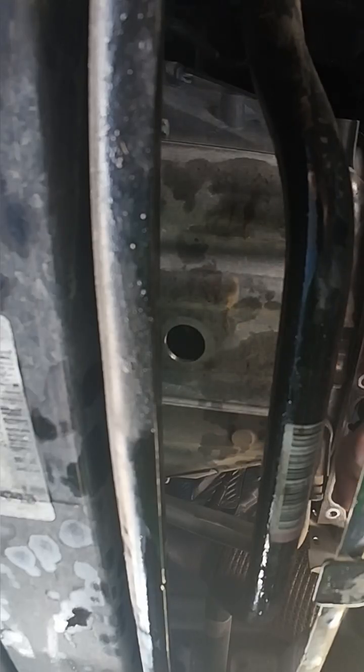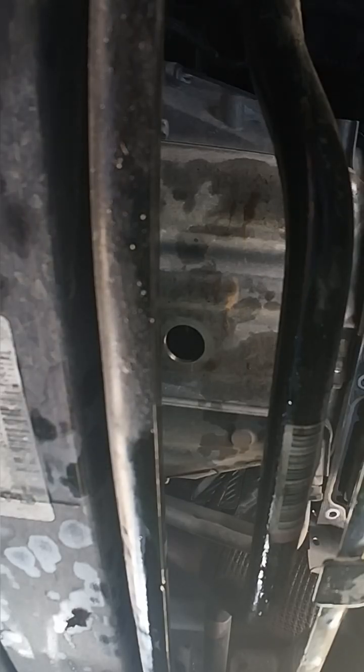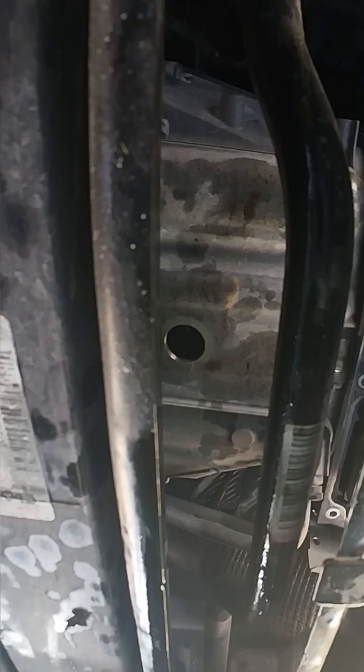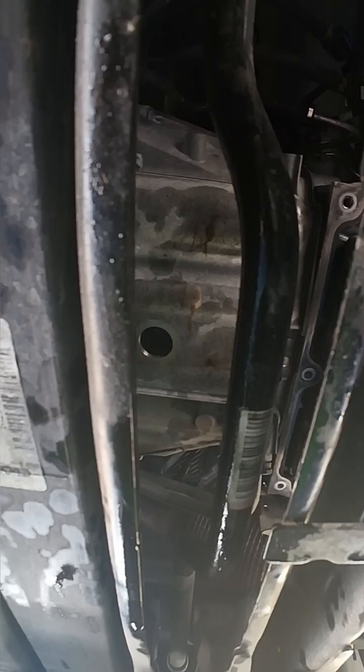It's hand tight. Now we're gonna use a torque wrench to set it to 90 inch-pounds. It's 89 to be precise, but safe to say 90. Now that our drain bolt is torqued to 90, we can close this cover.